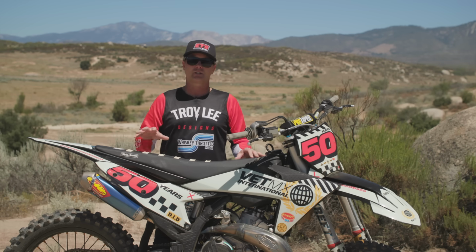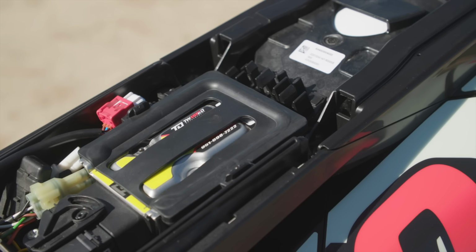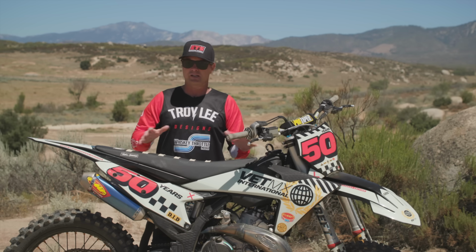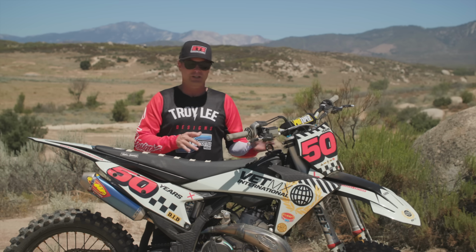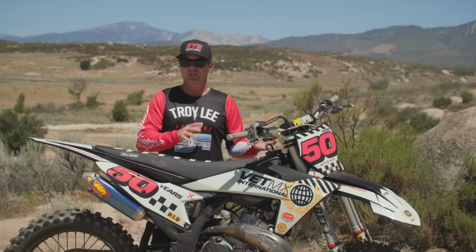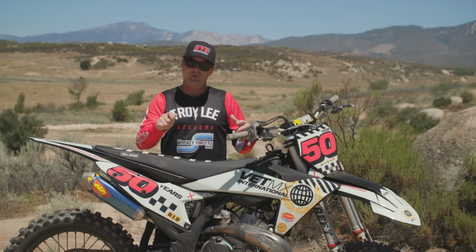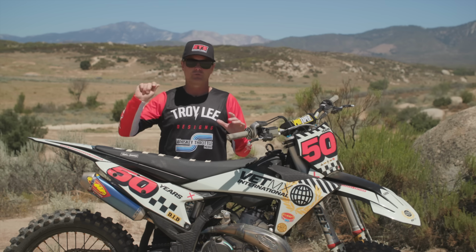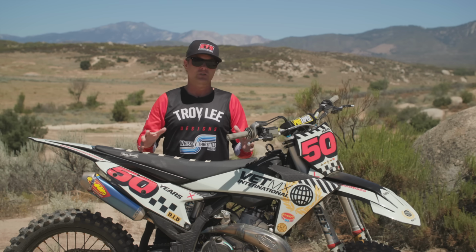We did take this thing to Twisted Development and had Jamie flash the ECU with all of the work he's been doing. And he's put in a lot of hours getting Jeff Emig ready to go to Loretta's and all the other guys out here, but done a lot of testing. He and Emig went through something like 60 some iterations of this map before they got it to where it is. Because this two-stroke fuel injection is new, if you have one of these, you'll notice this: in certain throttle positions, the thing will run up really lean. It'll start to kind of wind up like it's really lean. And then at times it can get rich when you get off the throttle and try to get back on it. So there's definitely some issues and some growing pains with the fuel injection.